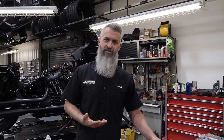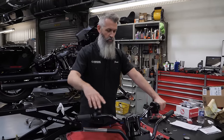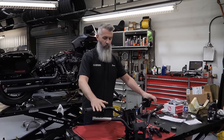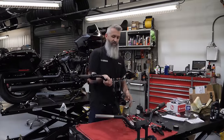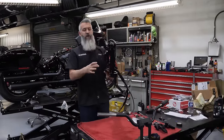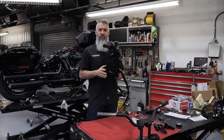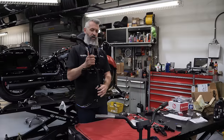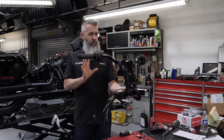That's why they work so well when we convert them over to a Harley Davidson handlebar. This whole setup is a more positive feel, a more comfortable feel. With the Krause Moto setup we have a ton of options — we can even take a T-Rex plate and move this guy further back, or you can get a straight riser. We like to go with the kickback riser on this bike, and we're going to finish it off with a brand new seat that pushes the rider a little bit closer to the handlebars.